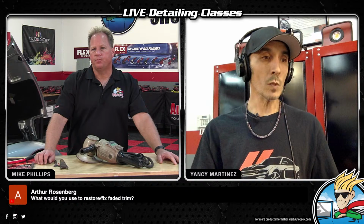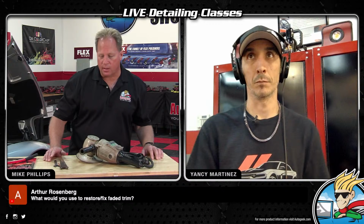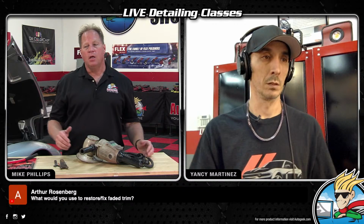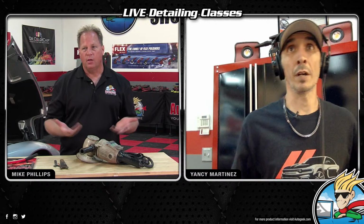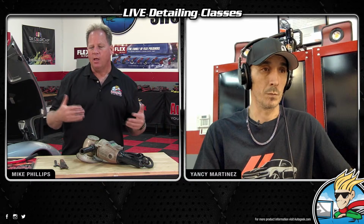All right, Arthur Rosenberg, what would you use to restore faded trim? Well, plastic or anodized? That's all he says. Well, plastic, I'd clean it really well, as good as you can, and put Solution Finish on it, and then top it with your favorite dressing. Solution Finish also just launched their own dressing to top the Solution Finish. And actually, it works really well on my wife's Jeep too. Solution Finish is carbon black milled to the size of a virus, so it can get into the plastic. It's not a dressing. You want to put something over the top of it, but it will bring the black back. If you're working on anodized aluminum trim like you find on high-end cars, I've had really good luck using the Blackfire One Step with the microfiber pad on the Rupes Nano in rotary mode.